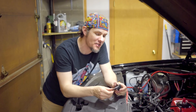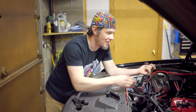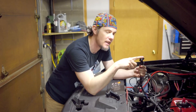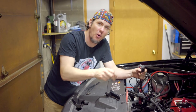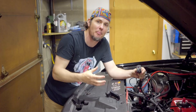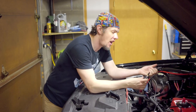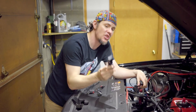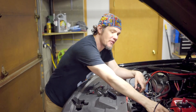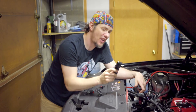Unlike the old Gen 3s, when you do a MAF delete on a Gen 5 you can't just do away with the sensor entirely. You have to have breakout sensors. Right now I still have my barometric sensor broken out — this harness here is for if you are running boost but still running your factory MAP sensor, because the barometric sensor is built in. If you don't break it out, it will see boost and make your atmospheric reading shoot up. Normally it's reading atmospheric pressure in your intake track, so you have to break that out.